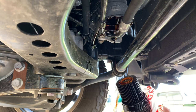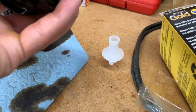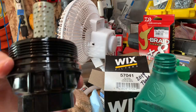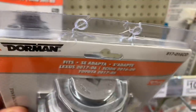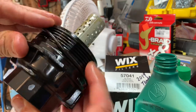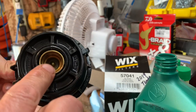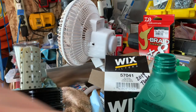So we've got this old Wix filter. It's draining out, so now we'll go back to the garage and put the new filter in. If you'd like to make less of a mess, you can actually unscrew this underneath and use a plastic piece to drain the oil filter out. This is just a factory plastic housing — you can get an aluminum upgrade. I'm going to take the O-rings, make sure they've got a nice little coat of oil on them for pliability, make sure it's placed in the right groove. Replace that one, screw that back in, and drop the new filter in. That's all there is to it.